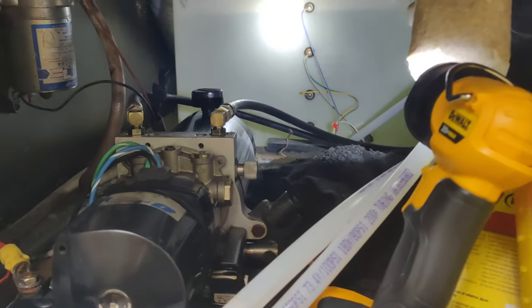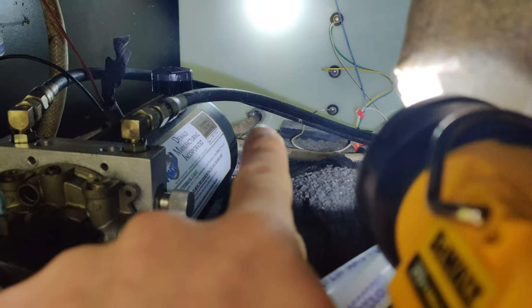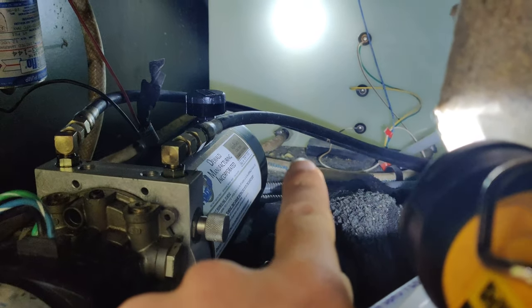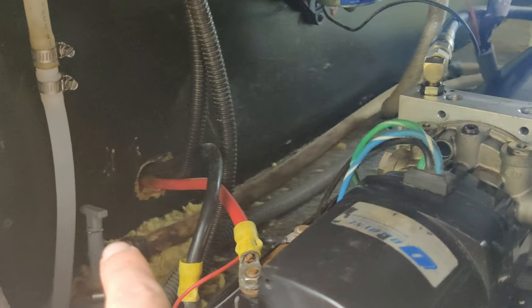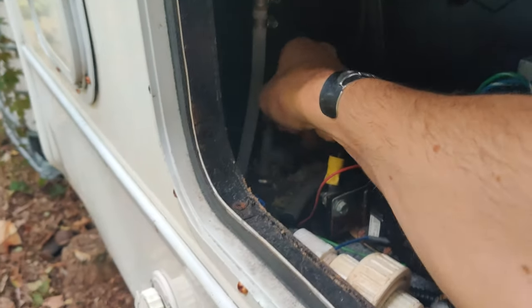Okay, we're outside the camper. One of the first things you want to do is find the fresh water tank, and at the bottom of the tank you're going to find a drain line to drain the tank. Follow that hose along the side to this valve right here — it's a pull-style valve. Just pull that up and the water will start draining out of the tank. It's going to take a little while, so we'll let that drain while I gather the tools for the next step.